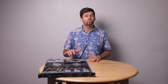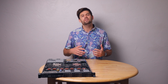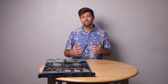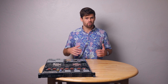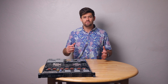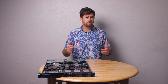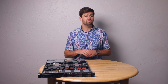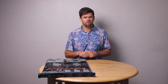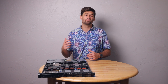Finally, the network card is going to be what makes or breaks your NAS for most use cases. If you have a one-gigabit connection, you're going to be limited to 125 megabytes per second read and write speeds no matter how fast the server is. But if you go up to a 10-gig card, you can easily squeeze out one gigabyte per second. This setup here is overkill for most people. You can really just take any old used computer from a few years ago, start throwing in 3.5-inch hard drives, and have a great performing NAS using TrueNAS.